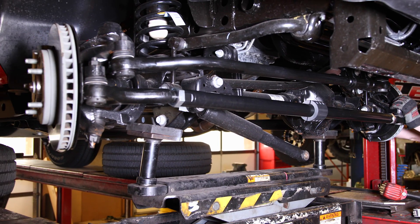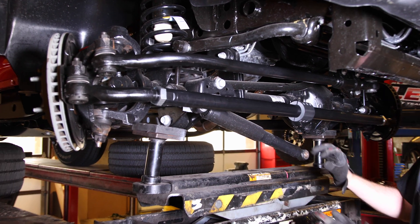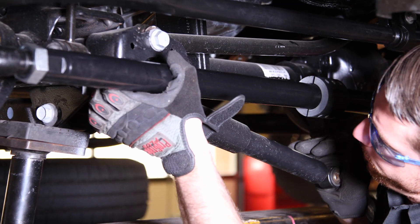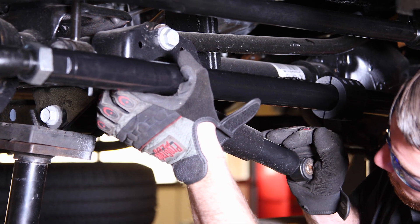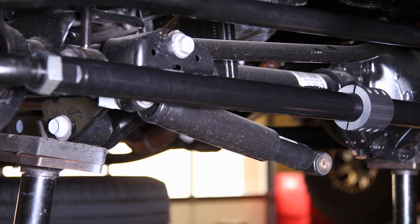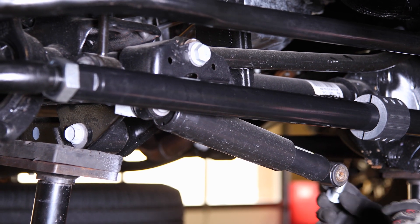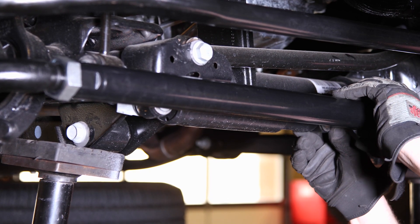Reinstall the stabilizer shock. With the wheels turned full right, the shock should be just shy of totally collapsed at this position. Push the shock to full collapse and pull it back out just a quarter of an inch or so, just so it doesn't bottom out at full turn. Using your oversized shock mount, double check for clearance and shock travel, then final tighten.